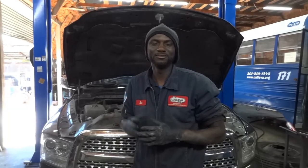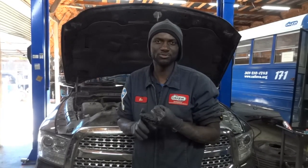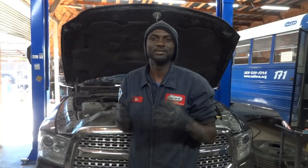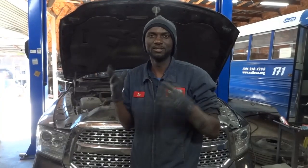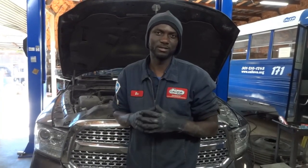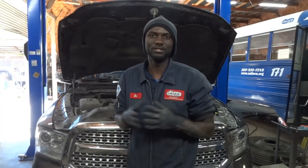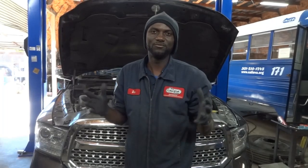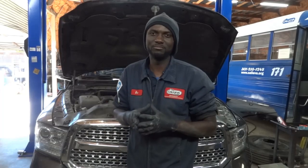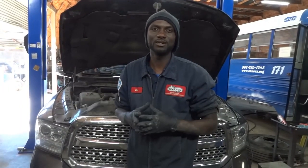This truck is fixed. This is how you fix a no-communication problem on any truck — if you have a computer that's not communicating, you have to make sure you check your powers and grounds first. If you have power and ground at the computer you're testing, then the problem is going to be the computer itself. It's the same process whether it's an ECM, TCM, or BCM. In this case the problem was a connector that wasn't latching correctly. If you liked the video give it a thumbs up, leave comments or questions in the comment box, subscribe to the channel and ring the bell to get notified every time I upload a new video.